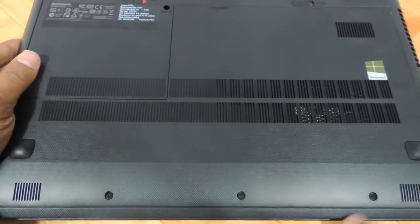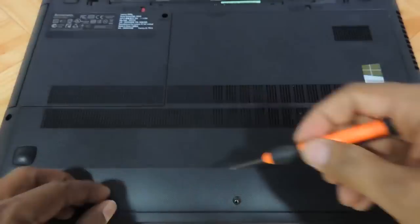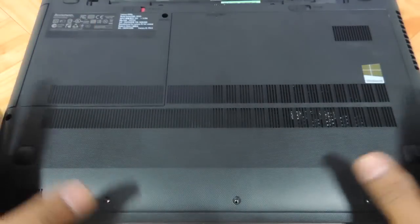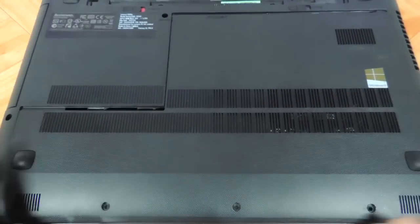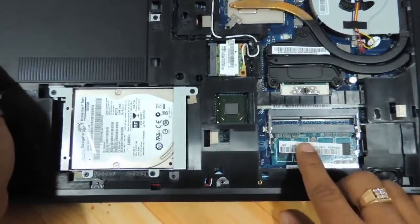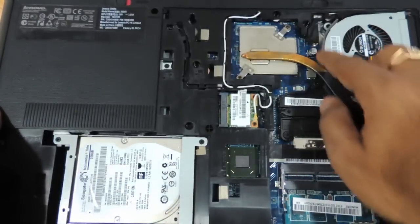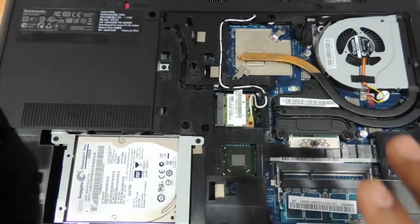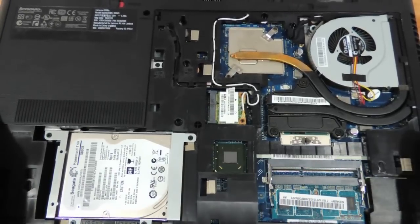You need to remove these three screws. Keep the screws on one side — these three screws belong to the panel — and then very gently pull the panel towards you. As you can see, I have pulled the panel and it is out. Once removed, you see the RAM, the hard drive, the Wi-Fi chip, and the fan of the processor, which can also be removed and cleaned. The design is very nice so that cleaning and upgrading the laptop becomes as easy as possible.